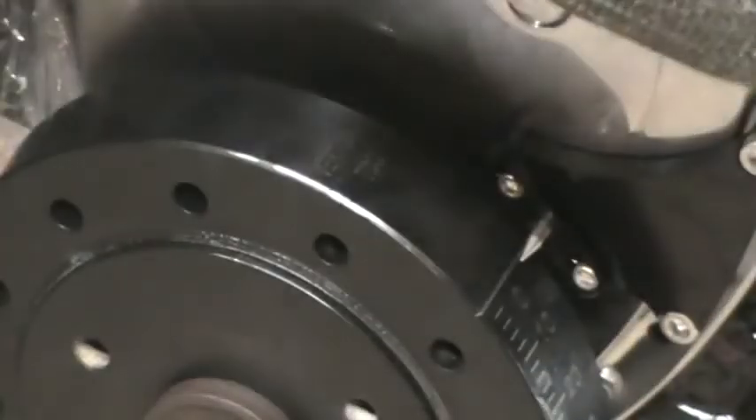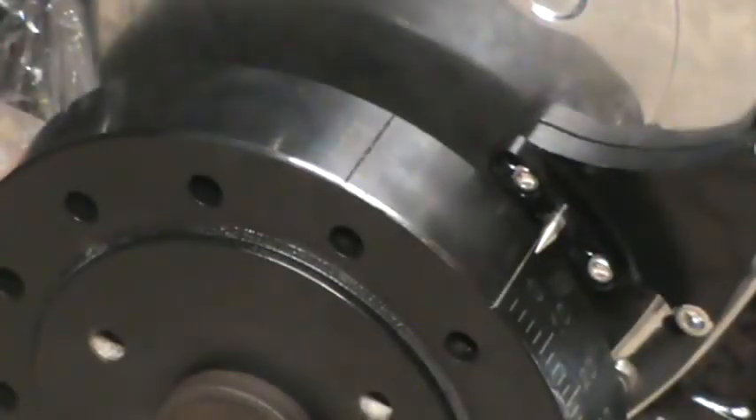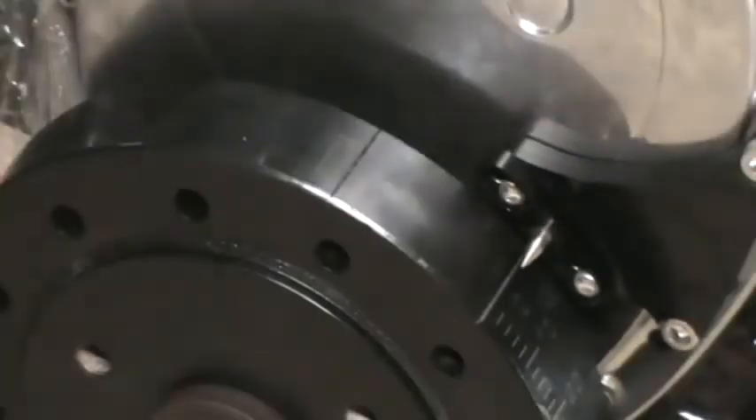Like I said, you can do this with the heads on — you need a different type of piston stop that goes into the spark plug hole — but other than that, you put the piston stop in, you turn it one direction and mark it, turn it the other direction and mark it, find the middle of those two marks, and set your pointer to that mark wherever it is. Then take off your tape.